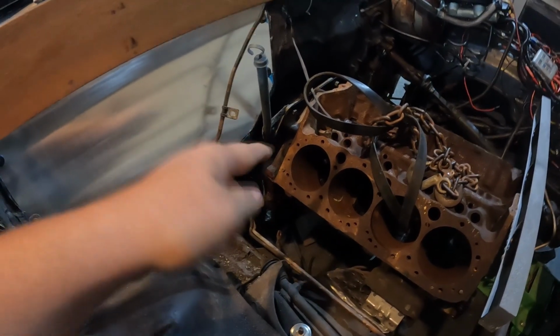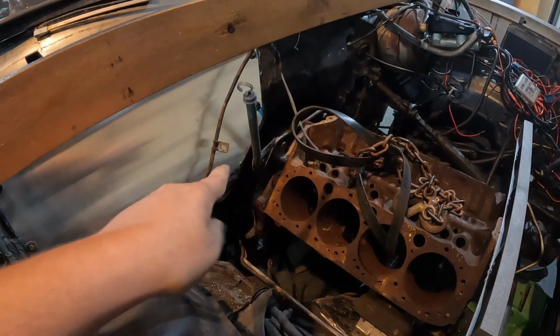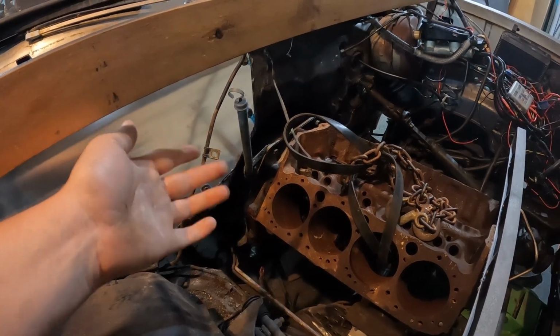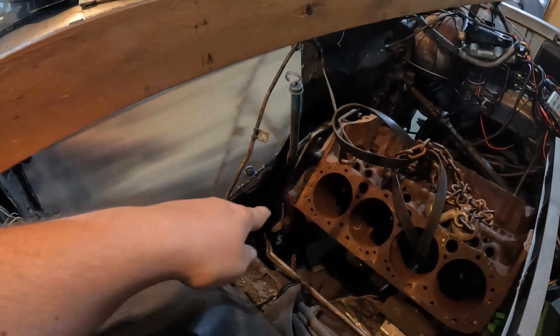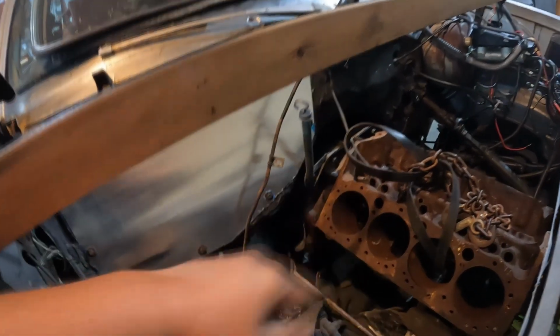4 as well. But what I'll do is I'll take the Pontiac or the BOP Turbo 400, shave it down to where I can get a bolt in to the top right there, hopefully. Maybe not. We'll figure it out. But what I'll do is I'll bolt the plate to the motor first, then set it in, then bolt it all up. If I recall right, the dowels hold most of the pressure from the motor and trans, and the bolts just pretty much keep it located, keep it from flexing and whatnot.